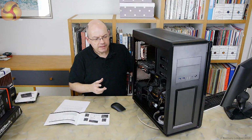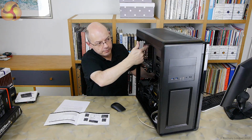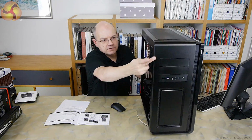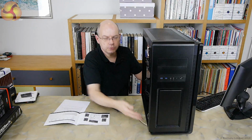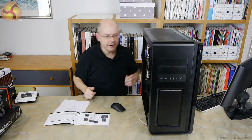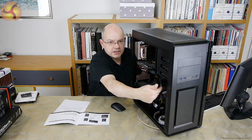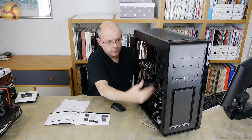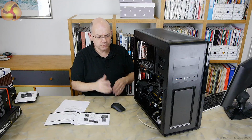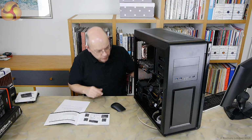You also run into some detail hassles. So obviously I've got the front drive I/O panel to power and control the Mini ITX board. But that has a very slight sort of step to the bezel, so it has to slide in. Once it's in place, you can't just pull the front panel off because the front panel won't clear it. It wants to pull this caddy back out, which if you then wish to install a liquid cooler here to gain access to the fans, you have to remove the front panel. So you need to do that before you put this in place. And there's an awful lot of, I have to do this before I do that. The sequence of the jobs ends up being really precise.